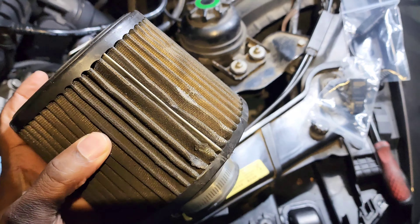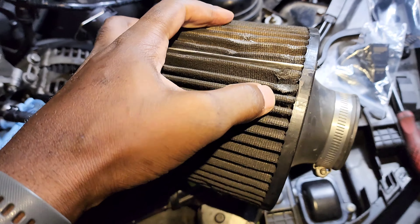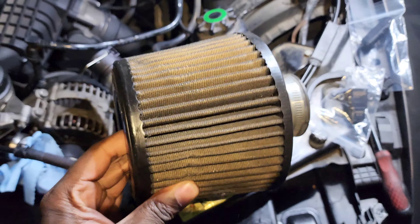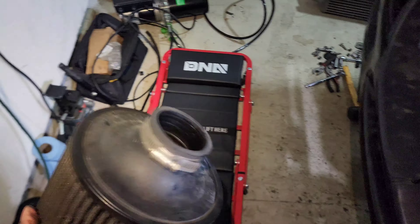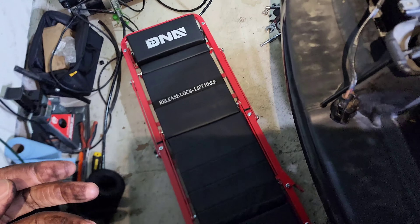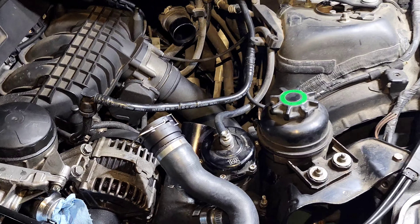The cold air intake is out. I need to clean this again — or just buy a new one. They're pretty easy to clean: dip them in some soapy water, give them a little scrub, and there's an oil you need to put on it. Let it sit and dry from its bath, put the oil on it, let it sit and dry again. Let me get my light in here so you guys can see.